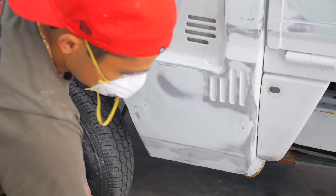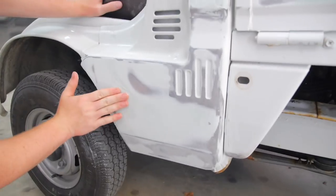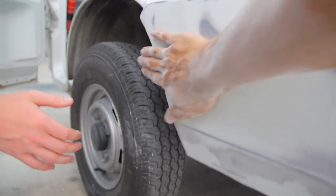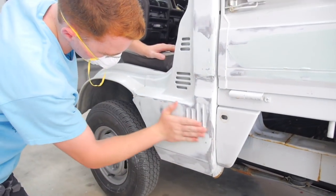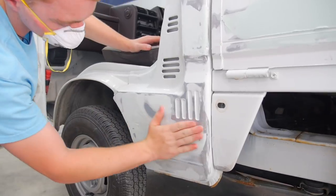So you could put some powder on your hand and see if you can feel the low spots, high spots. Feel the low here and the high here. Yeah, so if you're going, it's good sometimes you gotta go long strokes, you'll feel it quicker. You feel it, right? I do. All in there got to be refilled with putty, basically.